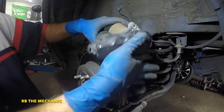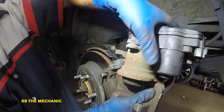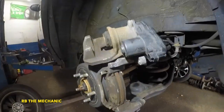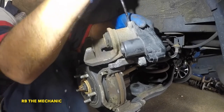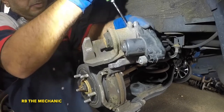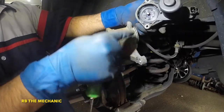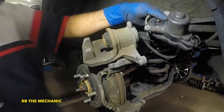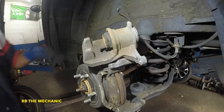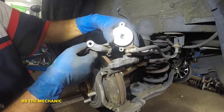No more bolts — it's just seized up from rust and corrosion. I'm going to use a screwdriver to help pop it off. You see that seal right in the middle — that's what's causing trouble. This is a motor; it has a belt inside and one or two gears that turn it. Keep it straight and pull it out just like that. If you need to replace this actuator, it's just two bolts. Remember to lube the seal — I put a little bit of lube on it.